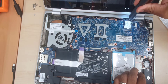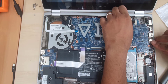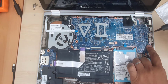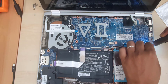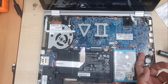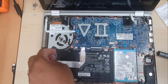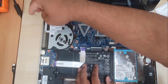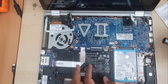We need to remove a total of four screws: one for the Wi-Fi antenna, and three screws from the actual motherboard. First one, second one, and there is a third one — I forgot it at first. Once I started pulling a little bit, I found some difficulty on the right-hand side corner. Also, don't forget the fan has two screws that we need to remove.